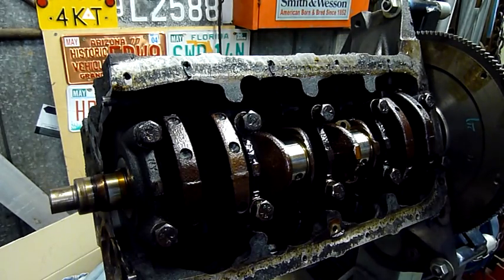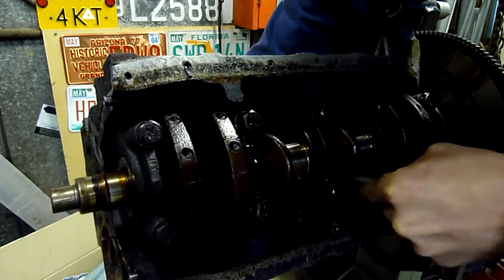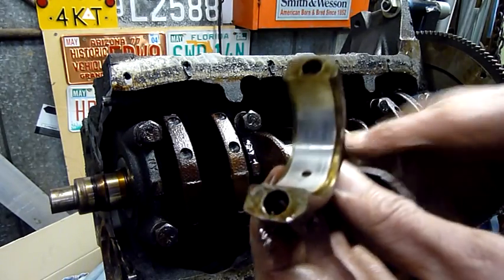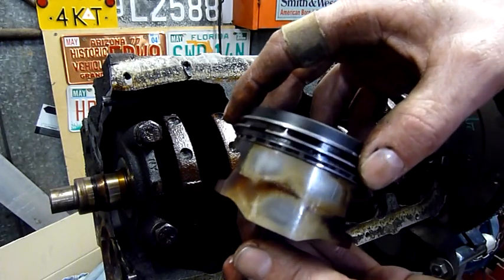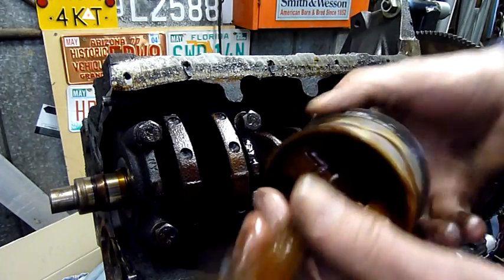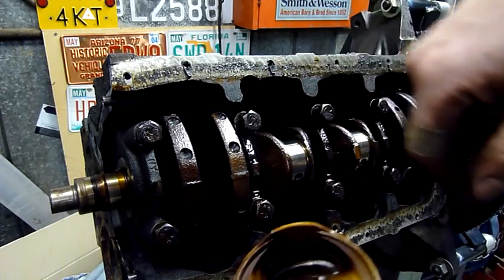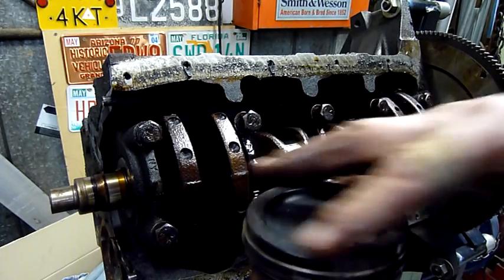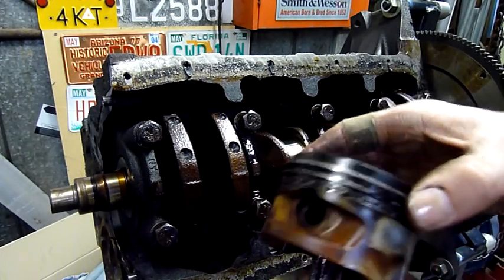About the same deal — same level of wear and tear. A little bit of pitting in it, just where the white metal starts to come away. It's got those characteristic marks on it. There's nothing much in there apart from stress points here and there. So that's the result of the piston slapping detonation, which has also cleaned all the carbon and crap off the top — so violent, it works pretty well. Compression rings are still fine, they're not smashed apart.